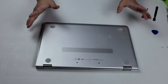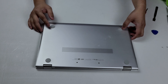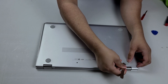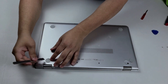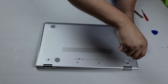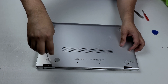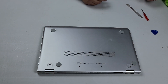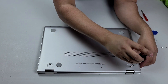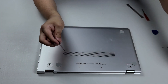Now that those are done, we're going to remove two more screws. The previous owner actually took these two off and stripped the first one. The only screws left are actually under the two pads at the back, so we're going to lift those up — these are just Phillips head screws. I'll use a little Phillips head to remove these two. They aren't coming out easily, so I'll magnetize the screwdriver by putting a magnet on it. There we go — the magnet gets those out very easily.